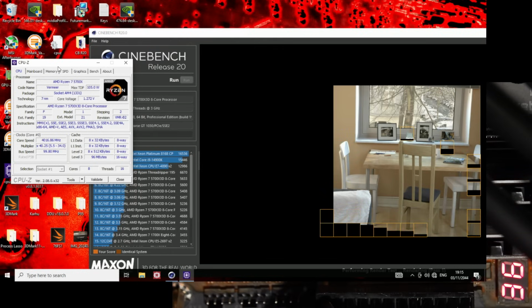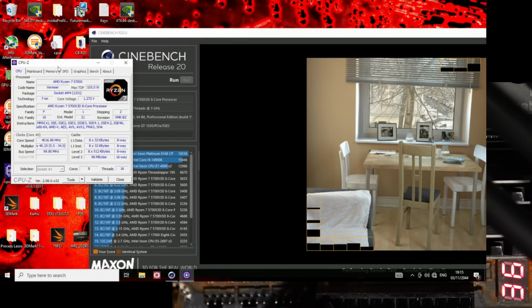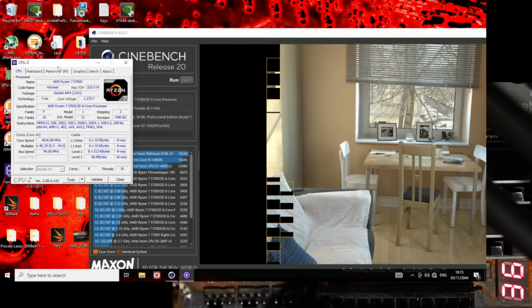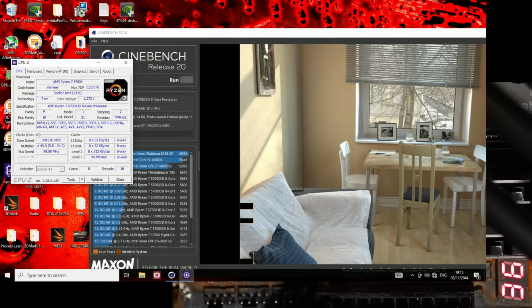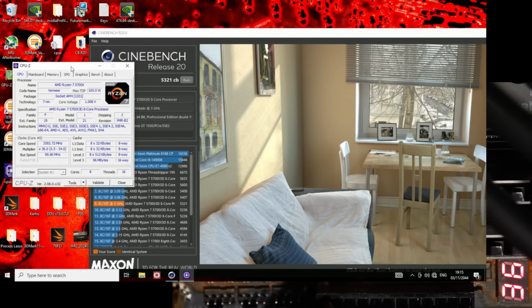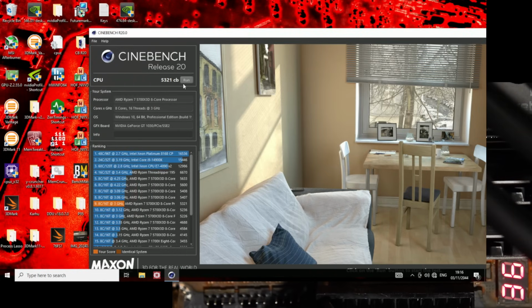For the auto core voltage tuning, the auto boost tuning on this CPU, this is so much voltage for 4 gigahertz. You could easily run 4.2 if you could just tell the CPU to run at 4.2 instead of 4. Now, admittedly, the silicon lottery is a thing, so maybe some 5700X3Ds would only hit 4.1 on their insanely high stock voltage, but that would still be better than not being able to do anything. Also, this is way higher than what I'm used to seeing from the CPU.